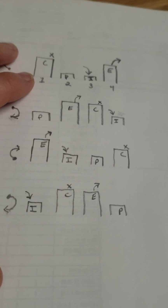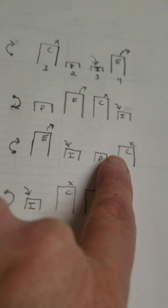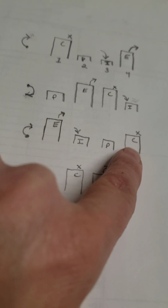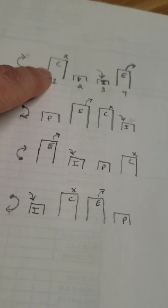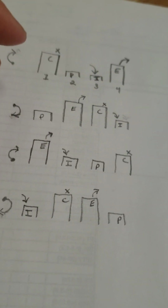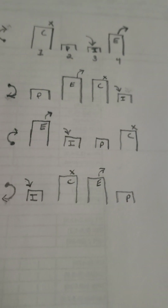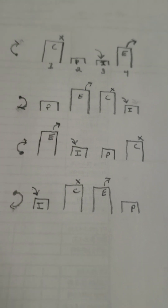If you get to top dead center number 1, you try to do the test, you discover you're really on exhaust, you don't have to turn the crank. Just skip down to cylinder number 4, because that one will be on compression. If number 1 is on exhaust, number 4 is on compression. So do your test on that, then turn half a turn, go to number 2, test number 2, do another half a turn, go up to number 1, half a turn, then end on number 3. And that will still be the most efficient way to do it, whether you start on TDC compression 1 or TDC compression 4. You can still do this with just 2 full turns, a half a turn each time. So hopefully that makes sense.